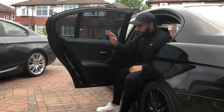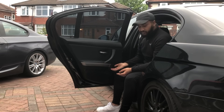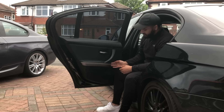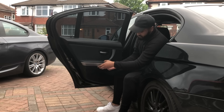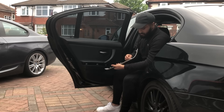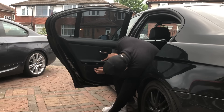Next, we're going to start with the back doors. First thing you want to do is remove this trim piece. You can either use a trim removal tool or sometimes you can use your hands and try to get in beside it. Try not to snap any of the clips off and you can just pull — you might feel like you're breaking some of them.